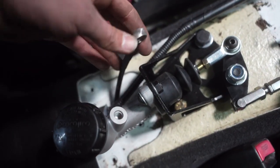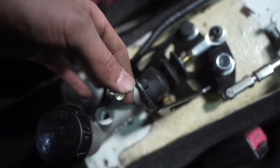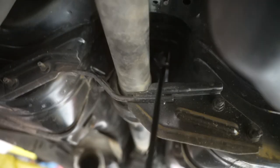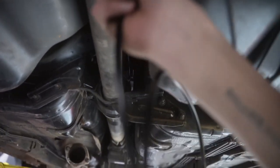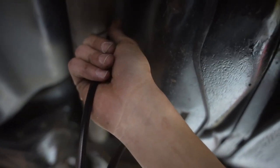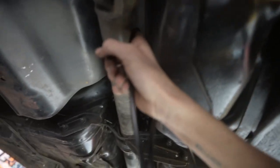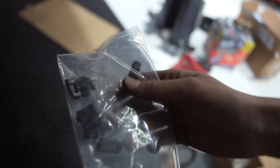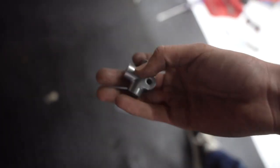You run this and then you run it to a T-piece, and then from the T-piece to each caliper. Now underneath the car, we have this line being fished in through the factory hole. I just have to make sure I run this as high as I can. I'm going to retain the stock clips so it doesn't accidentally touch the drive shaft while it's spinning. If I notice it's a little too close to the drive shaft, I could use the provided clips. I have to get this T-piece mounted up — I'm probably just going to drill this one into the car somewhere just to be safe so it isn't dangling, because this does have a good amount of weight.